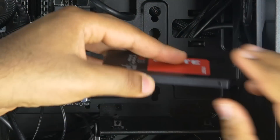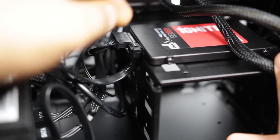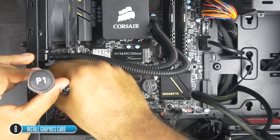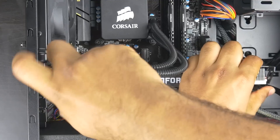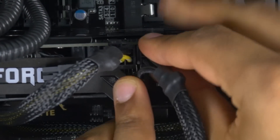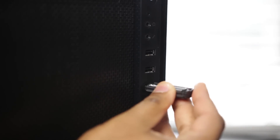Moving forward, install the 480GB SSD drive. The N200 case has a couple of areas for SSD drives — I'm simply installing it at the bottom area for easy access. Screw it into place, then connect the SATA power and SATA data cable from the board to the drive. Installing drives is a pretty simple and straightforward process. Last but not least, align the GPU with the PCI Express slot, remove the PCIe covers on the left-hand side, slot the GPU into the 16x 3.0 slot, secure it with the two screws, and install the two 6-pin power connections from the PSU to the graphics card. And that's it — you've built your computer and you're ready to install your OS, applications, and games.